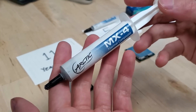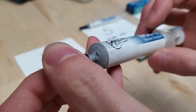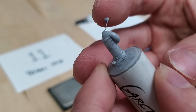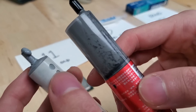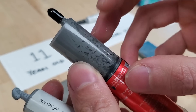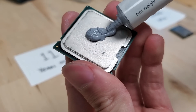I want to start by actually looking at these older tubes of thermal paste themselves. This large 20-gram tube was purchased in 2013, and upon initial inspection does not appear to be over a decade old. The fact that this paste still has as much liquid as it does inside of it is a really good sign — mainly because it hasn't completely dried out, unlike this other tube of thermal paste where you can see all these cracks, which is the separation of the metal oxides and the silicone oil. I'm already pretty impressed with how this thermal paste is looking.